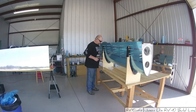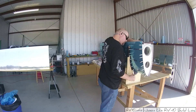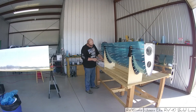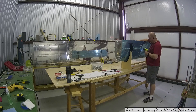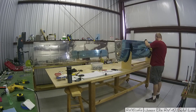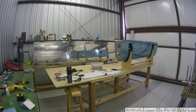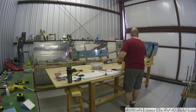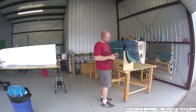Here I am putting the ribs in. Of course with the ribs you've got to get them all lined up and get them all straight, Cleco every other one, and then once I have them all Cleco'd up I begin the drilling process. Every once in a while you'll see me go look outside because there were people in the pattern all day. This is one of those things I skipped ahead on because you've seen it. This is like the next morning - I went out and was drilling all the holes. It's dreadfully dull and you guys probably don't want to see me drilling all the holes, but again it was a beautiful day so I thought, screw it, gonna open up the hangar and have some weather.